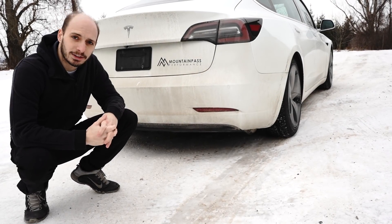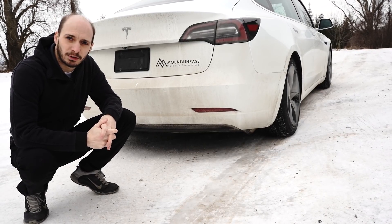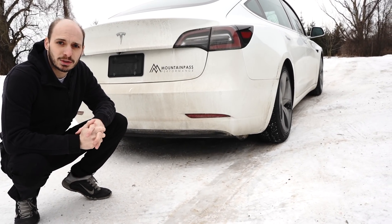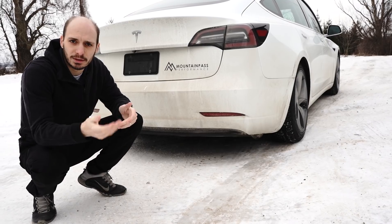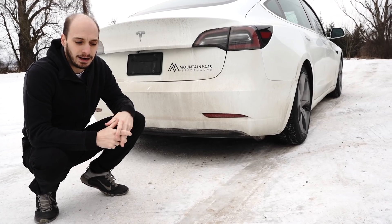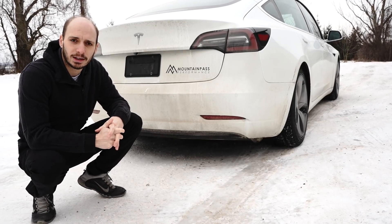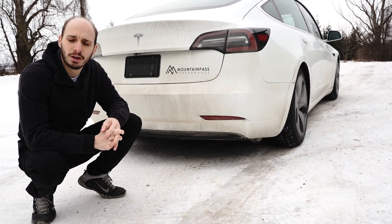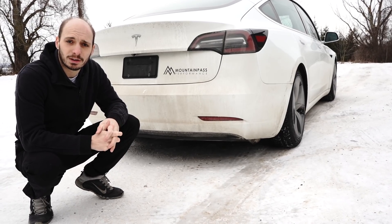So that's it. You can see why having some control is desirable. I figure that tire was going about 220 kilometers an hour, the diff was making crazy rumbling sounds, and I think that tire hardly spun at all. So yeah, have some fun with this stuff but don't be stupid. There's nothing like a normal car with gears that's going to limit how fast you can spin the tires. With an open diff you can spin one side way faster than the other, which is a great way to damage your differential. This is kind of why we developed the party box — so you can be on the track, be full throttle, and have the car control what's happening. For all-wheel-drive cars this is also a good fix for guys that just want to turn off stability control, or if you've got racing slicks and traction's not a big deal. So enjoy it, don't do anything stupid, and if you do, don't blame us.